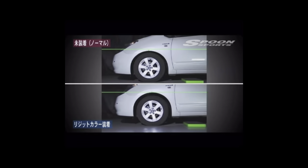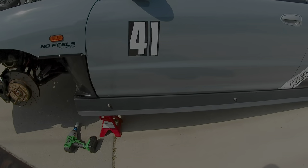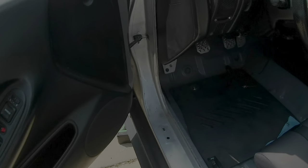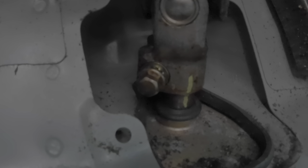To get started, I already have the car jacked up and the wheels off. On the inside I came up here and loosened up that steering joint in the back. You can see the yellow mark where I marked it with a paint marker to try to get it all back together — I still haven't got the car aligned yet. The rest of this video is going to be filmed underneath the car; I'll grab some sockets and we'll pick back up from there.